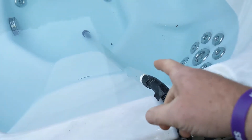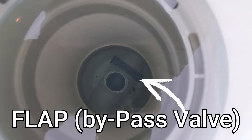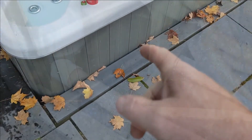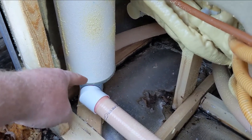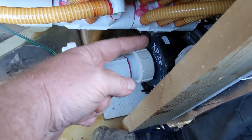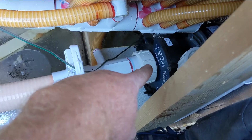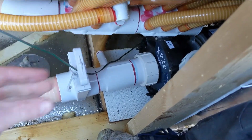Power's off and I just put the quick drain in. Right on the bottom there — that's where the flap's supposed to be. I'm also going to take this side off here — maybe it got stuck in the pump. Located the pump. So that piece would have gone from there right to the front of that impeller — there's no way it can get through. So it's not going to be over at the element. If it's going to be anywhere, it's going to be in front of that element. Hopefully it's not stuck right before there, because it does narrow down.